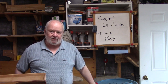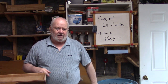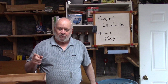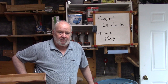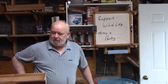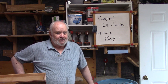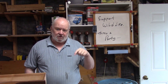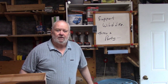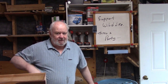Anyway, we'll see in the next couple of days — I've got some windfall I need to block up and haul away so we'll see how good the saw works then. If you have any ideas of what might be wrong, let me know in the comments. I'm getting a new plug and I've ordered a new coil, so when the coil shows up I'll put the coil in and the plug. The fuel filter was replaced last fall and it hasn't been used much since, but there was old fuel sitting in the saw so maybe the fuel filter's clogged up too — I have a new one I could put in as well. Thanks a lot for watching, please click like and subscribe, and take care, stay safe, wash your hands, look out for your neighbors.